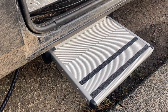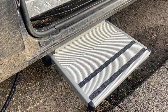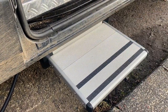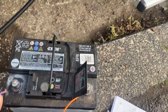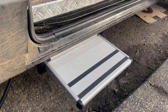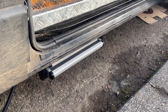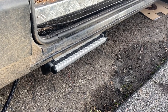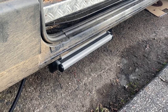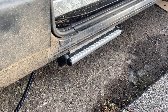I asked my assistant to just step on there to make sure my brackets are okay — and back out. Excellent. For testing purposes I reversed the polarity of the orange and purple wire, and it goes back in. I'd advise you to do this as soon as you've mounted it, because then you'll see if you've over-tightened it anywhere and can avoid any possibility of it jamming or sticking, either on the way out or on the way back. I'm going to call this a success and go ahead and wire up the switch.